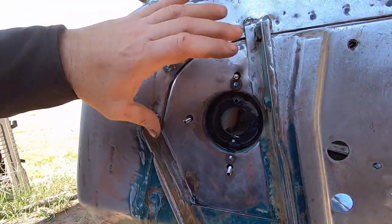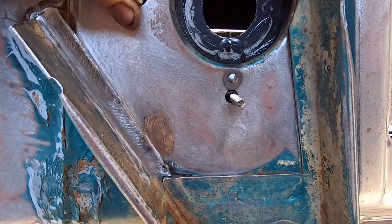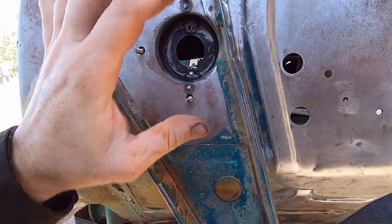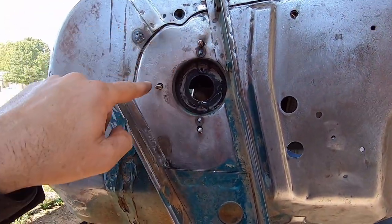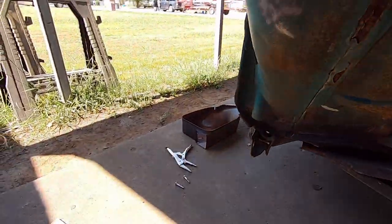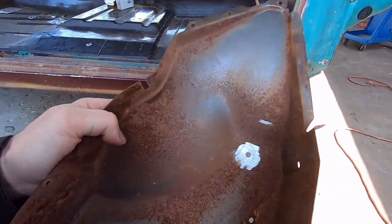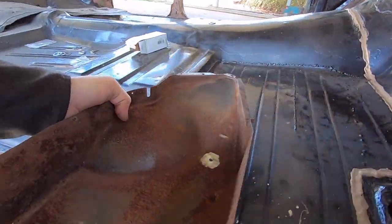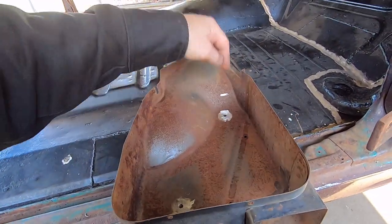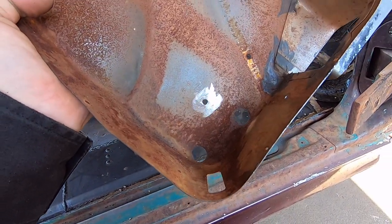Now I have stainless steel hardware coming out of the firewall instead of steel, so I can put a stainless steel flange nut on here and it'll look a lot cleaner. There'll be these three for the blower motor and one here and one up here from the main heater box. I went in with my 90-degree angle grinder with a 36 Norton Blaze disc and ground until the stud pretty much fell out, then ran a quarter-inch drill bit through to open it up and make it true again.